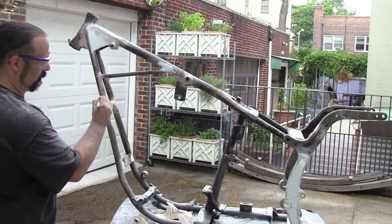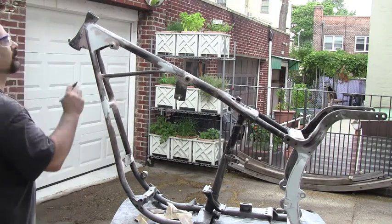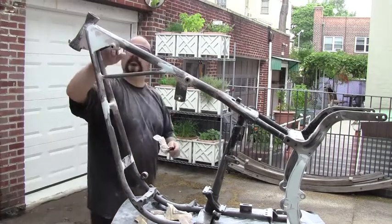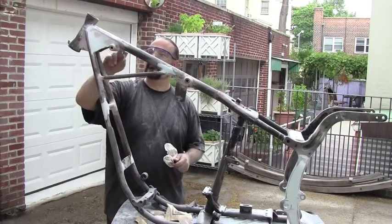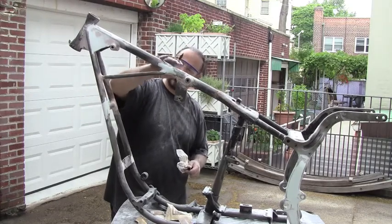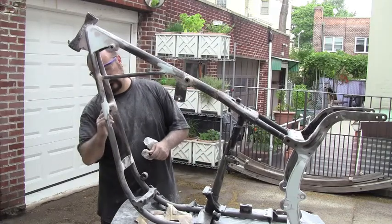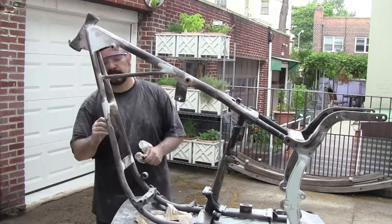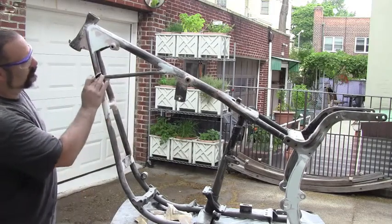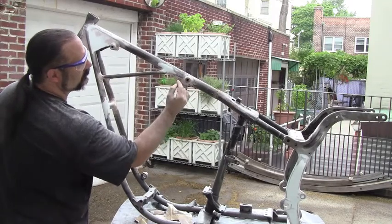After giving the bike a good hand sanding, I like to go around with a black magic marker and mark every area that I'm not comfortable with. Use your hands, not your eyes — rub your hands over the surface. If you feel it, you will see it. It is a much more precise way of doing it. If you feel a ridge, a bump, or a groove, mark it and go over it. It will show up in the paint. This is the critical part now because we want to get the last coat on and get this frame done and ready for paint.